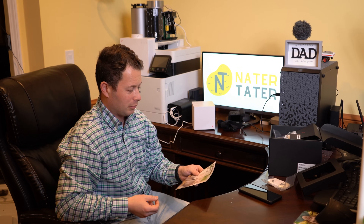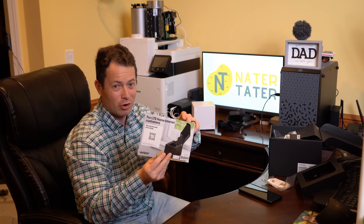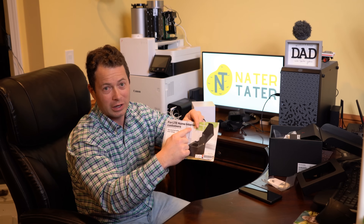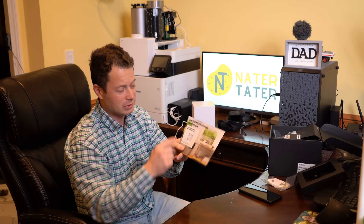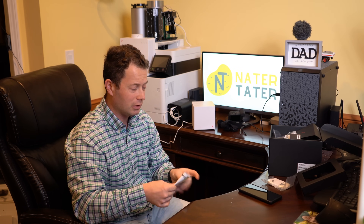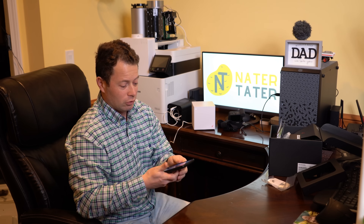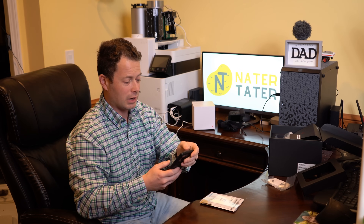Plugging it in, you can see the white light in the top left corner flashing — that means it's booting up. It might also flash red and white, which I think means it's doing an update. In the cardboard box there's a flyer with a QR code. It can be a little confusing because one side shows the cube and says 'for LTE customers' and the other side says 'for 5G home internet customers.' This is the 5G plan. The unit takes a couple of minutes to start, and you can use the app to help with setup — I'm going to scan my QR code.